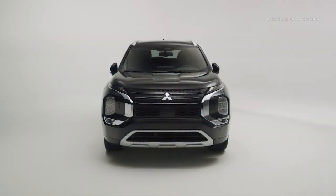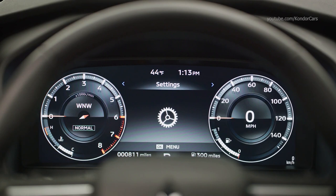However, if the warning is not dismissed, or if a rear door is not opened and closed again, the system will sound the horn after the vehicle is locked, as the driver walks away with the key fob. Of course, this system and alert can be customized, and it's important to understand where to find the rear seat alert system controls and menus.